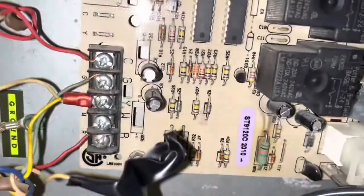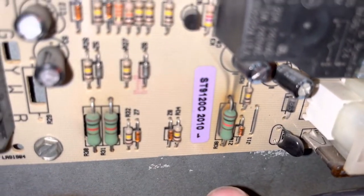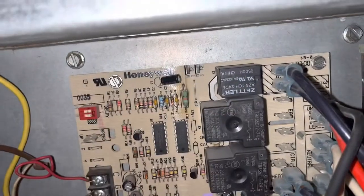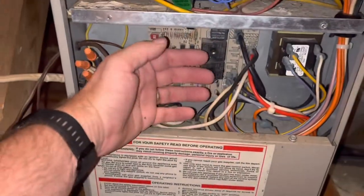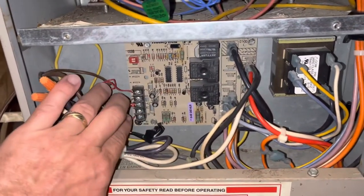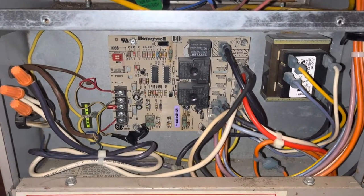One of the reasons I think this board was having trouble is this resistor right down here — it looks like it got really warm one day. So the way I'm going to swap the boards is: take the old board loose and out, put the new board in behind there, and do a one-for-one swap with each wire. I especially want to do that with these unlabeled wires over here. The six-pin plug is easy, but all these spade connector wires are what I'm more concerned with.